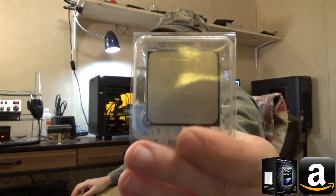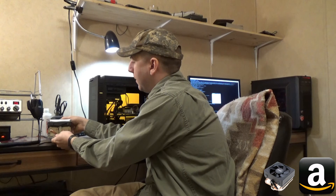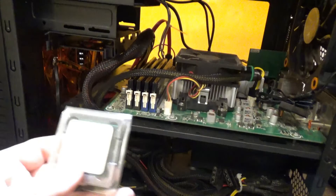What we're doing today is upgrading the CPU, which is the last part in this rig I'm going to worry about. I have an AMD Phenom 2 X6, a 6-core, 6-thread CPU clocked at 2.7 GHz that turbos up to around 3.2 GHz. It's used but I got it from Amazon, so there's a reasonable expectation of success. Since we're tripling the horsepower, I went ahead and grabbed the AM3 socket-compatible Wraith cooler, which should do a much better job than the old cooler with six cores underneath it.